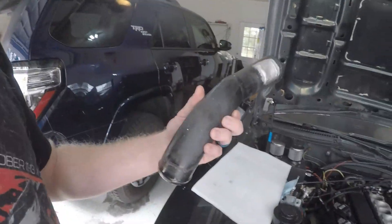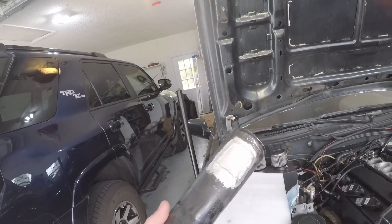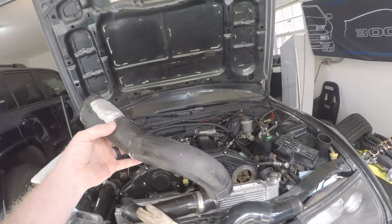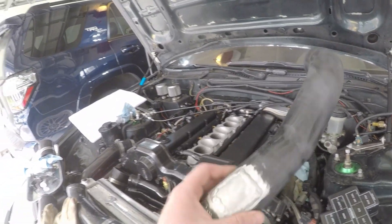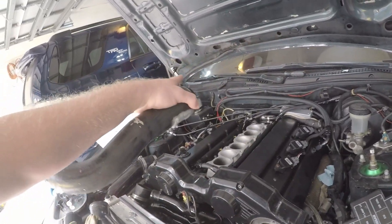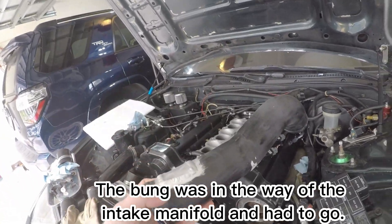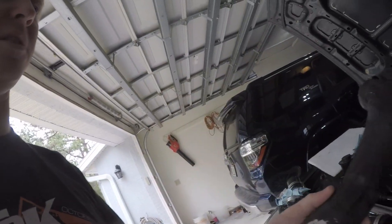One other thing — I completely forgot to mention it. I have all Ash Spec charge piping and intake piping, and unfortunately a lot of the piping comes with these little bungs. This one over here is off my driver's side turbo. It's gonna go back in place but I'm gonna paint it — I've got it sanded down right now. There was a bung there that went up into the PCV system for the PCV valves, but I'm not gonna run a PCV system on this. I've got breathers attached to the catch can and that should be plenty. Maybe one day I'll run a vacuum line to the catch can, but for now it is what it is. I'm gonna repaint this and reinstall it today hopefully.